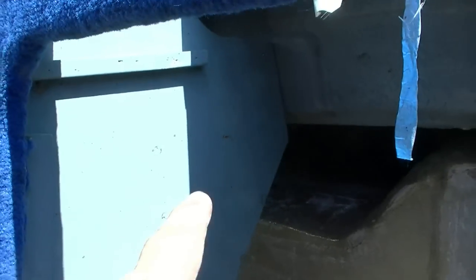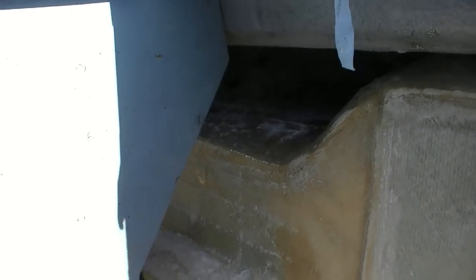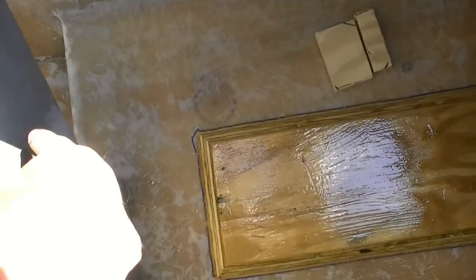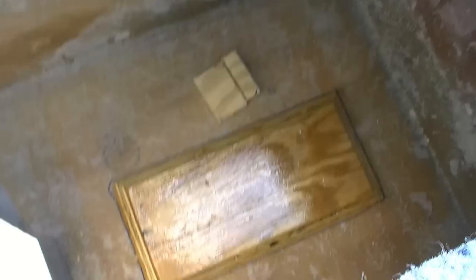I'm going to have to cut some of this factory original piece right here — I may end up remaking it. I'm going to have to recoat it with gel but I'll have to cut a pretty good little archway out of it to allow for the coarse exhaust to go through. Here's the trim pump mount — it's going to face backwards so the trim wires will come around here and attach to the trim pump. I'll have to extend the relay actuating wires for the trim pump, but that's no big deal. I've already marked the locations with blue marker, so I'm going to pull them out, mix up some peanut butter, and glue them down.